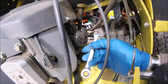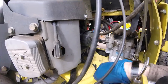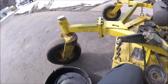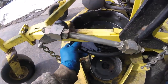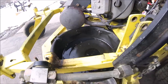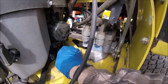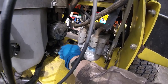I ran that clamp on there with a 10 mil wrench - these are almost always 10 mil, nine times out of ten. I drop the deck all the way down to its lowest setting, stick the oil pan in there, and try not to let it come up and touch the bottom of the muffler. Once you break that free, you can usually do this by hand - sometimes you can, sometimes you can't.